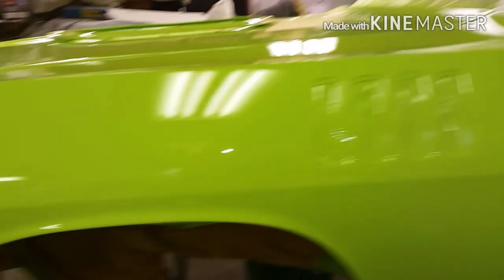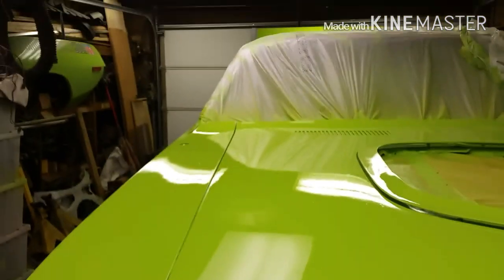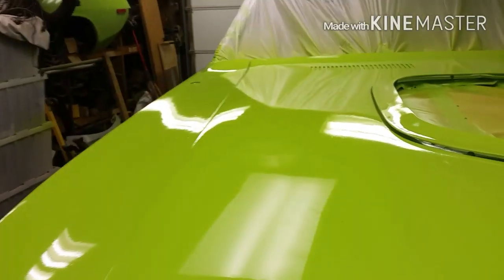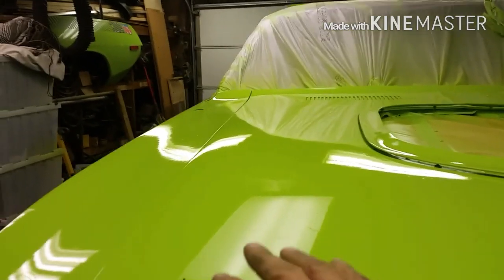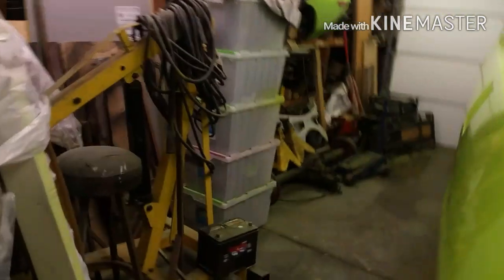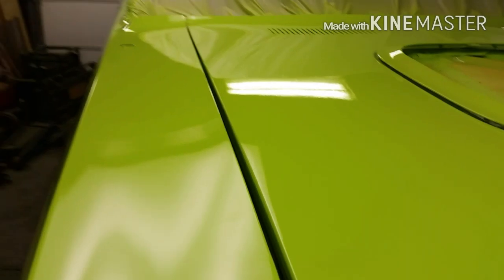There you go guys — it's done. Took a little power nap. There's the usual dirt, which I don't foresee being an issue. If you recall back when I did the hood, this clear wet sanded really nice — all I did was use the orbital pad with 1500 and 3000 and then compound, and it came out like glass. So the little specks in there — it's more like lint than actual dirt, no flies or anything — they should all come out.